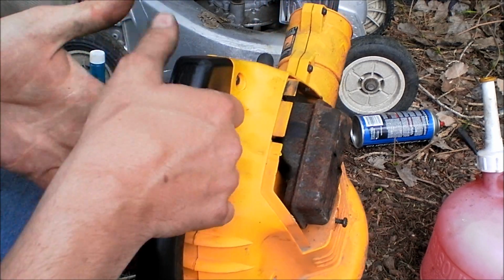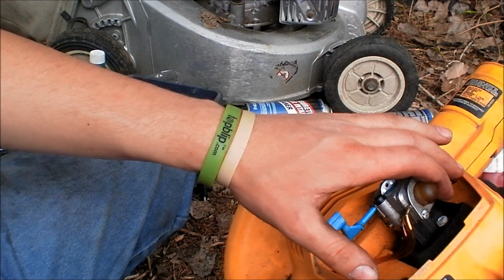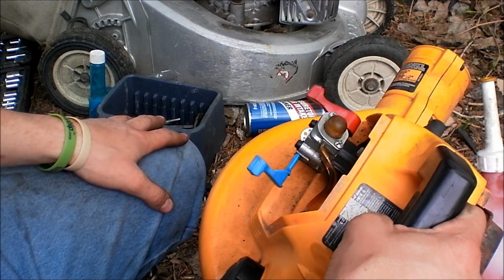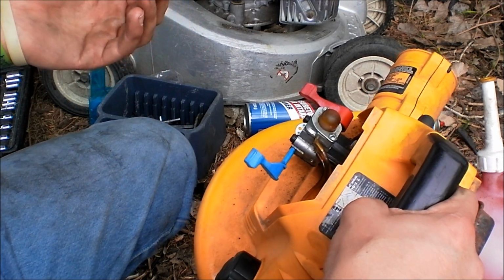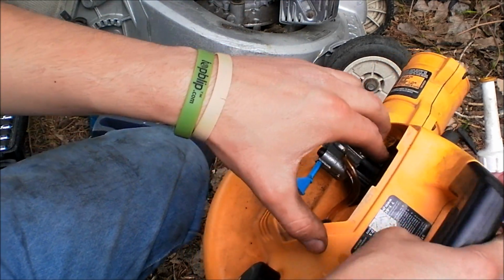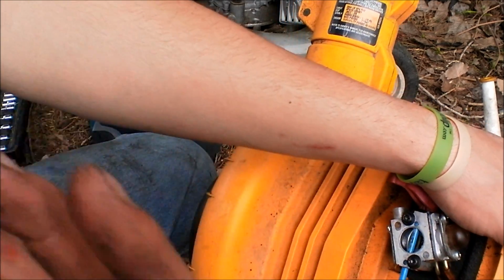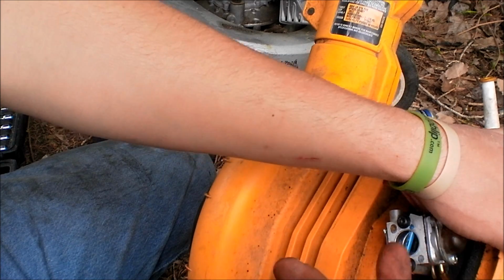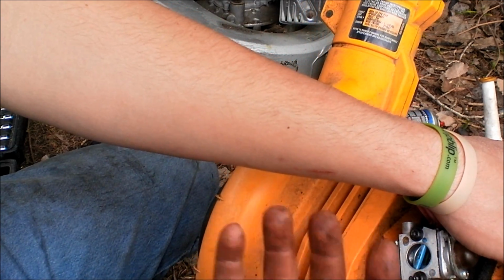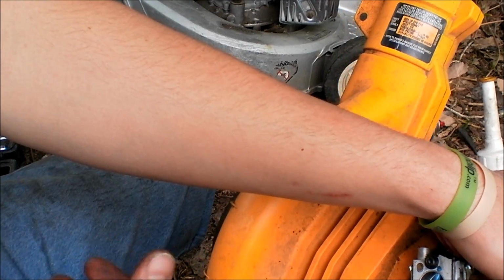It's going grrr. But when you start going on the lean side of things, you don't hear it in the exhaust at all. You actually hear it in the carburetor. It sounds like it's getting more throttle. I'll try to explain it the way I think it is, and then I'll explain it better. I think the noise that you're hearing is, there's less fuel mix going into the air, which is letting more sound out. That's what I think that sound is anyways, because when there's a heavier mix there, it's not making as much noise. Also, it's not having to draw so much air in to try to keep it running. And that's, I guess, the actual reason.